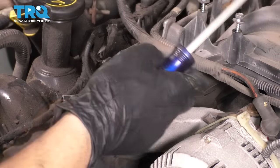There are two hoses at the back of the throttle body. One goes to this evap solenoid here, which connects onto the top of the two rear fittings. And then your brake booster line will connect onto the bottom of the two rear fittings. Press that on all the way, make sure that it's secure. Otherwise, you lose power brakes if that pops off.